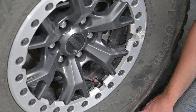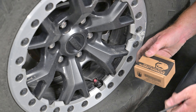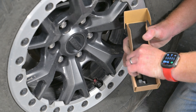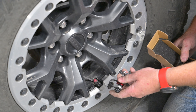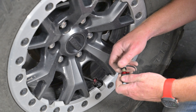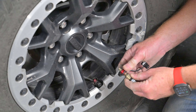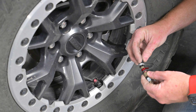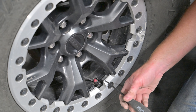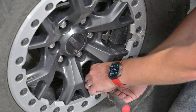You might have to just notch out the fender liner a little bit — I think I did that on the prototype here. You've got to see where that lines up. Now we've got the compressor in there. It's a good time to do the wiring. I've already got it installed on this one. The best way I found to run the wires is down and then across the bottom of the front core support, instead of trying to go up and over the radiator where it's hot. It's just best to go down, over, and connect to the battery.